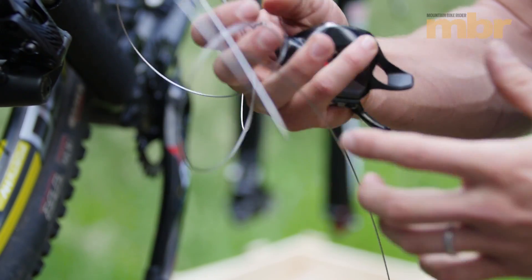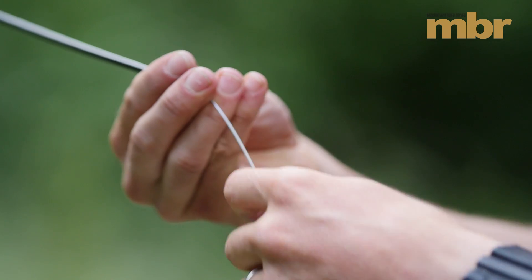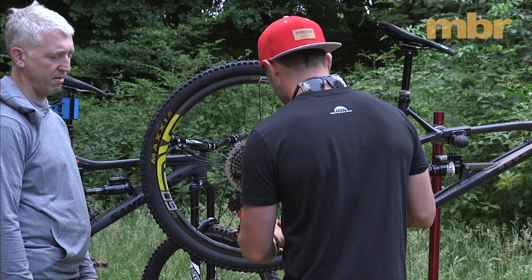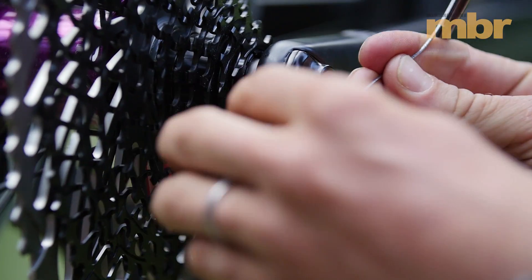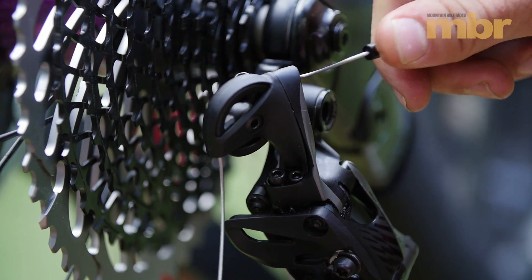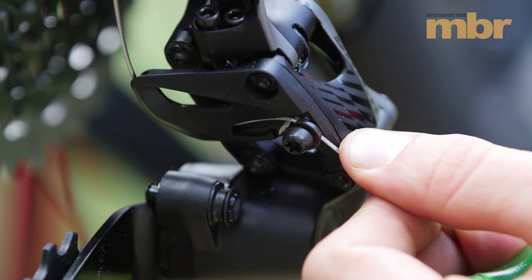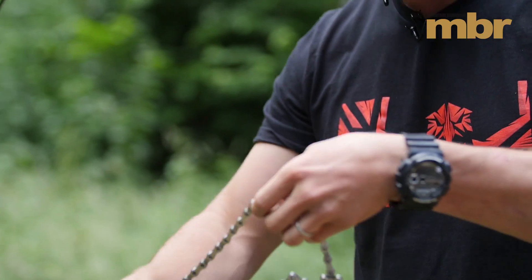The X01 Eagle gear shifter has an increased mechanism to account for the 12 gears, and it's also improved in itself — a little smoother and crisper than previous SRAM technology. The cable sits in the same way as on the previous XX1 drivetrain, routing straight in around the roller wheel. Make sure when installing that you're in the highest gear so the cable is fully extended.